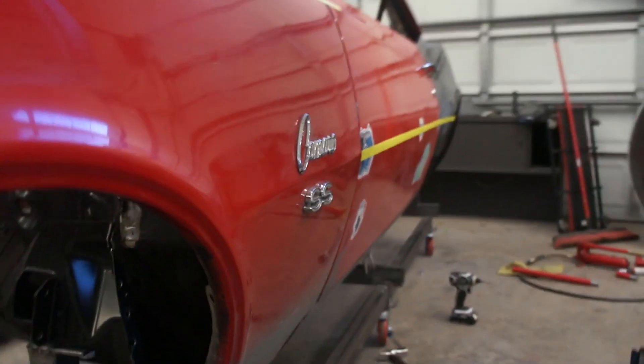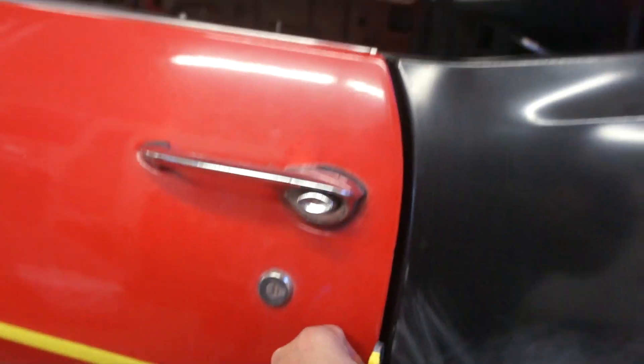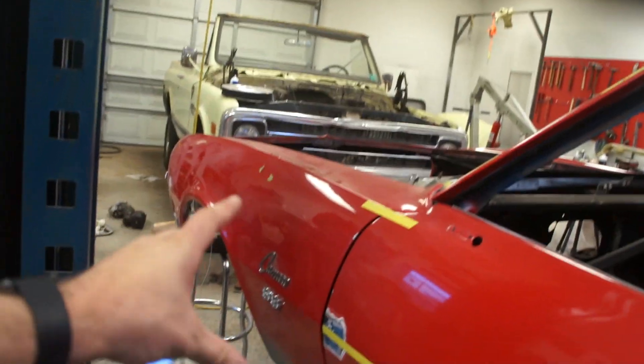Same on this side — you already saw that. Gaps, it's just hanging on here, so it's pretty close. Could gap a little bit — needs to be a little looser up here, so that'll come forward. I'll have to work these a little bit, but this is all movable back and forth. My main goal was to make sure that my doors are 3/16ths pretty much all the way up. That's pretty much the way that would live right there, which is really nice. The door lines and everything are good.